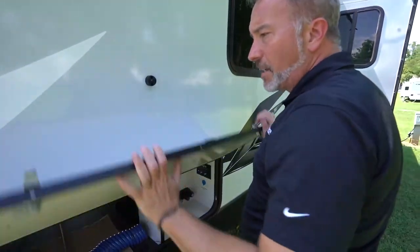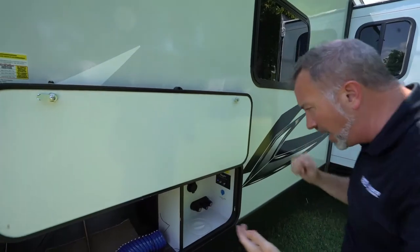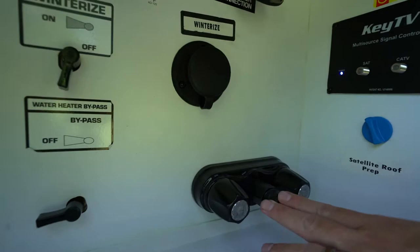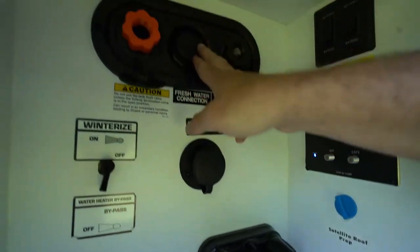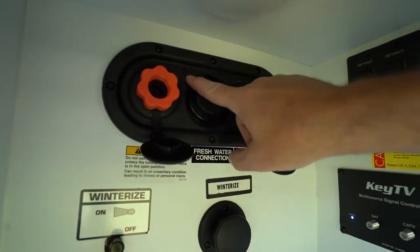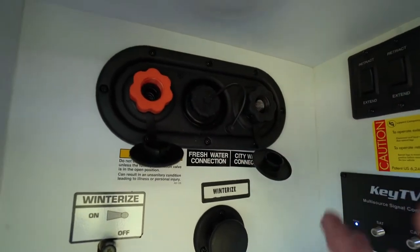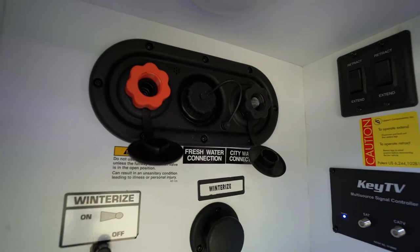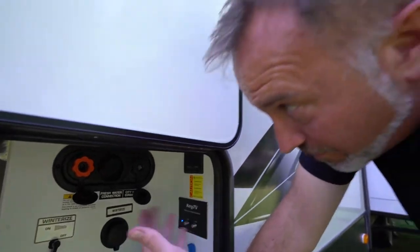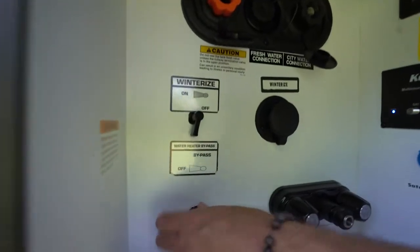You're going to have magnetic anti-slam latches on all your storage compartment doors, as well as covered hinges. There's a porthole right here for your connections, and an external sprayer/shower port right here. You've got your freshwater connection, your black tank flush, and your city water connection. That right there is the pressure valve. If you're going to be filling up the fresh tank with well water, just be careful — it may have some sediment or sulfur at the bottom. Clean your fresh tank out with white vinegar every now and then. Hot water bypass is right here.